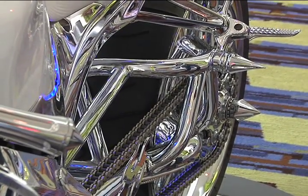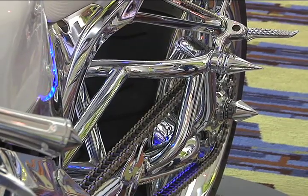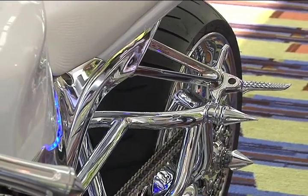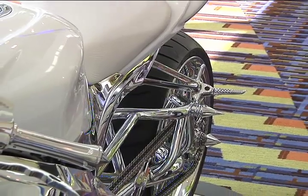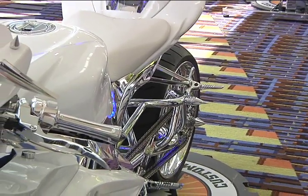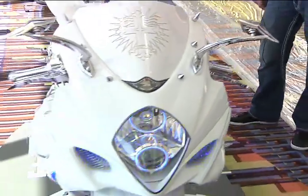Sort of a space frame type design for the swing arm then, right? It is. If you look through the back, it's actually offset about 1/4 inch to the one side to make up for the weight distribution. That swing arm by itself can probably be thrown about 100 yards. It weighs less than 6 pounds. But like I said, it will serve a purpose, and you can ride the bike at 160 miles an hour freely and not be worried about it screwing up or wobbling at all or anything like that.